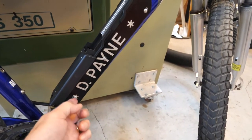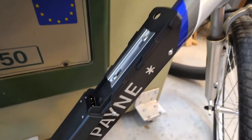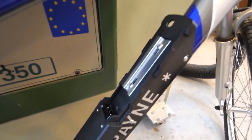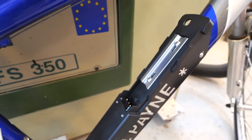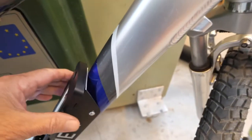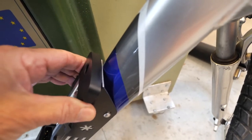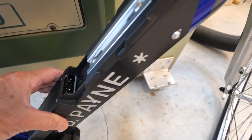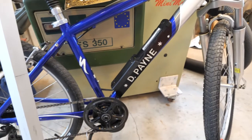There's one rivet here, one here, and one here. Then I used screws into rivnuts on the tube to attach the battery mount. So you can see that it's on a wide perch instead of just the narrow edge of the tube, and it's not going to wiggle back and forth as I go down the road.